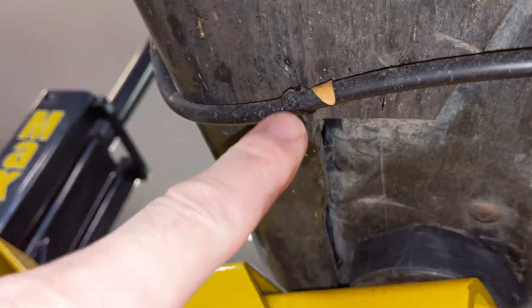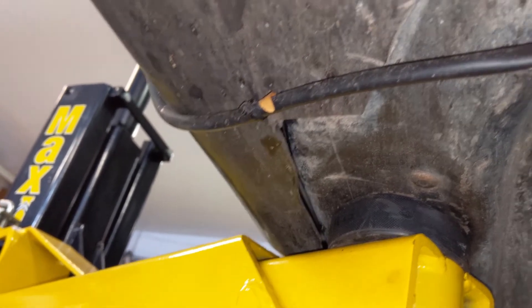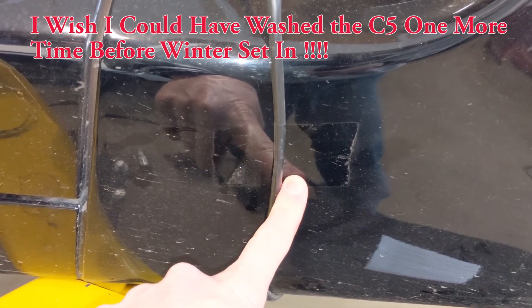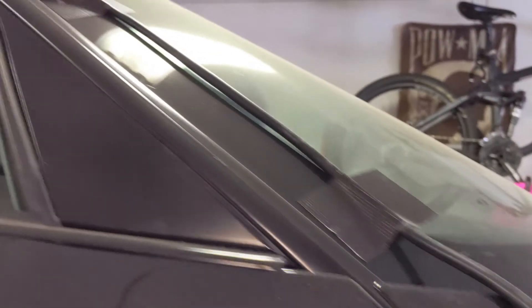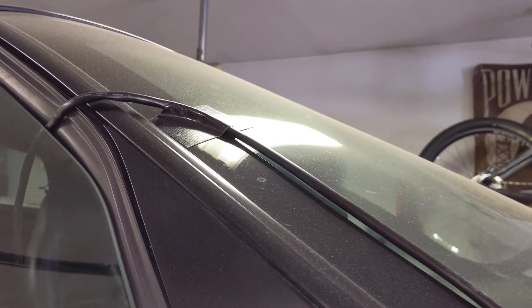I did drill a small hole in the rocker to have a small zip tie hold the cable up before it makes the bend up the side of the car. Moving along the outside of the car, all you really need is a piece of Gorilla Tape — duct tape will work in a pinch, but Gorilla Tape is much, much better, plus it's black so it hides better. One piece down low, one piece a little bit above the venting, and two pieces on the windshield, which clean up really easily with a little wax and grease remover or solvent when you're done. Down low you'd want to use wax and grease remover when removing these pieces so you don't harm your paint's finish, and put a little wax on when you're done.